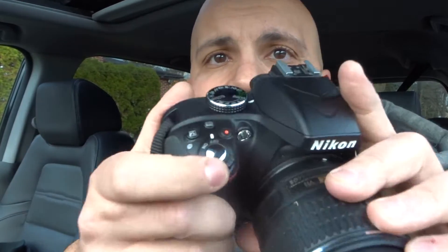There are five things that you can try out. Number one is that the driver might not be installed properly. The driver is what allows your computer to recognize the device plugged into it — your camera in this example. To test this, go into the drivers section on your computer, plug in your camera, and turn the camera on. If the driver doesn't pop up, that's your problem. Go download the proper driver from the official authentic website and make sure it's a safe download.